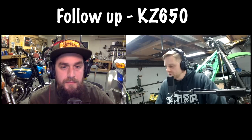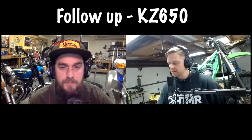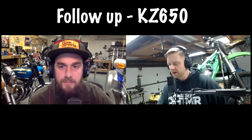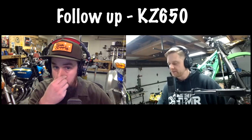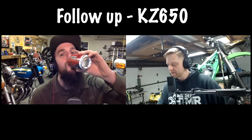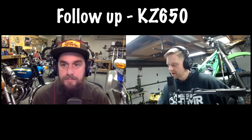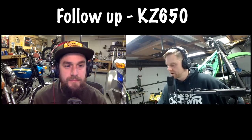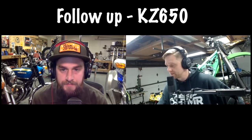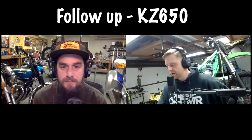After I saw my questions about my KZ650 smoking on your show, I went ahead and broke down the top end. The attached pictures show pistons 3 and 4 are wet, as are the corresponding valves. All cylinders look pretty sooty to me, but they're really good for 24K. The cylinders are all within spec, no ridge. Pistons look like new, with 2 thou fitment, so I guess the piston to wall clearance is 2 thou. The rings look so good I'm almost tempted to put them back in.